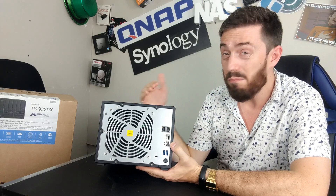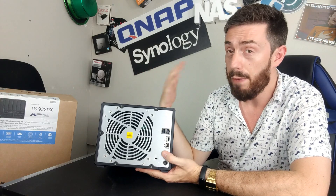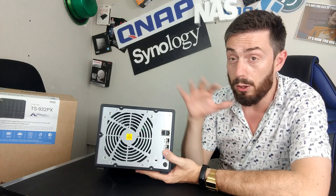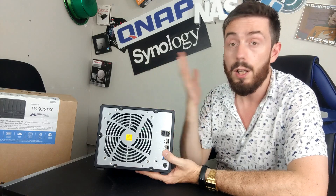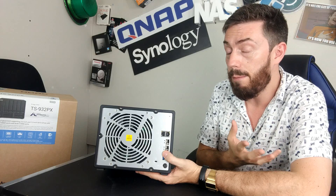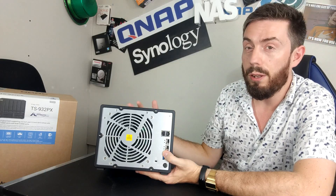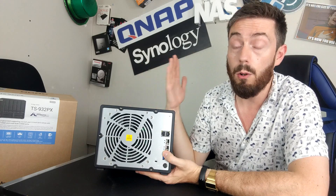It doesn't have HDMI or any HD-out, so KVM setups for surveillance aren't going to be possible. You need to focus on file management. Utilize Virtual JBOD if you want to turn this storage into something accessible and fast elsewhere, or use Hybrid Mount to port available storage from cloud services and other NAS services using the cloud gateway tool — both for backup with Hybrid Backup Sync 3 and general file management.